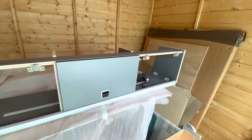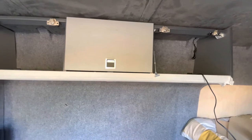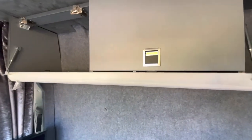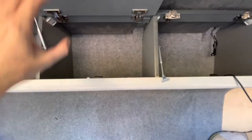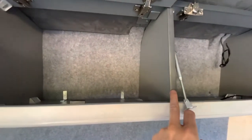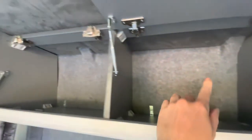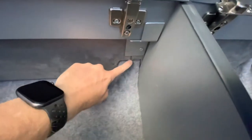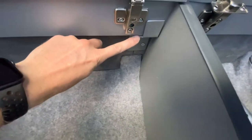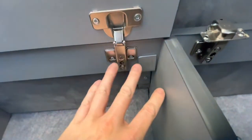We have the shelving locker in. Just going to show you what we've done to mount it, to help anyone fitting these to a Crafter. The middle locker right-hand divide lines up exactly with the rib — it's the second rib along from the B pillar, so one, two, and that one butts up against there. I've actually made an L-shaped bracket, or a Z-shaped bracket — it's got a slight dog leg because I didn't want to foul on the hinge for the door.